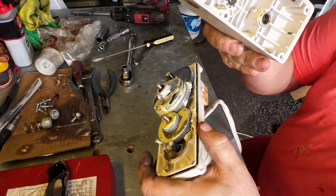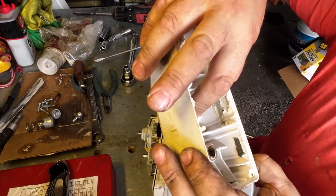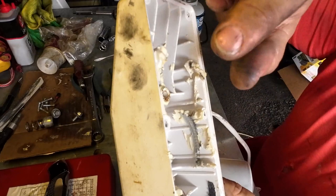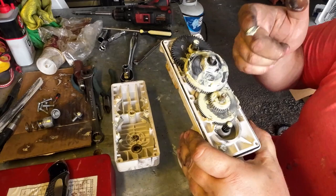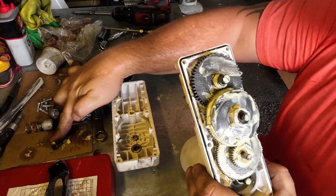There's a bearing here, a brass bushing up here on plastic. I don't know if you can see that — it's oblique in there, so that gear is off to the side a little bit. I'm not feeling any lips on this brass bushing here. The grease in here is old but it's still lubricated. You can see how dark it is over here — that would lead me to believe there's some wear going on under there. This is a clutch for the motor.